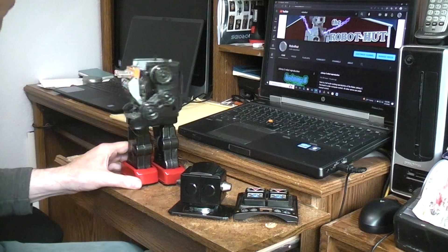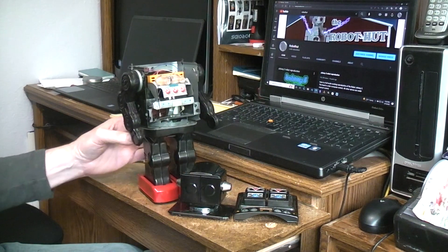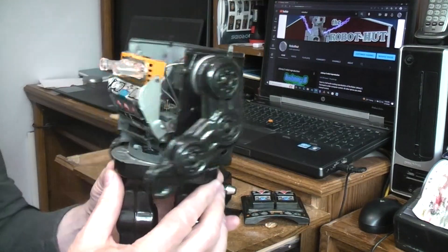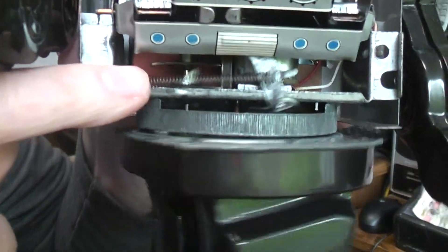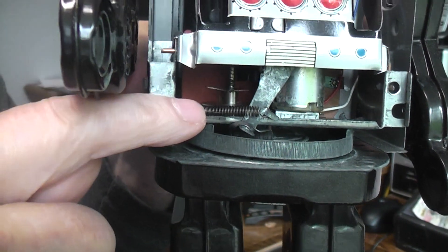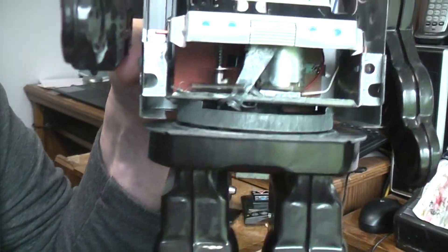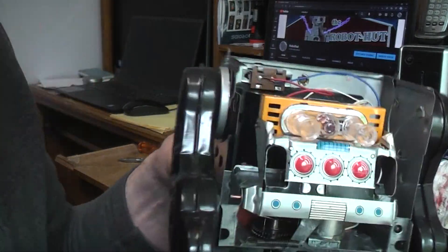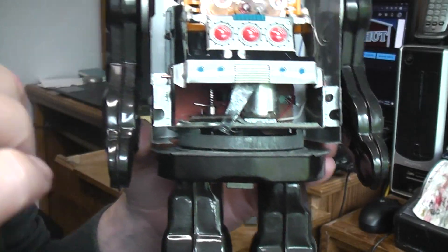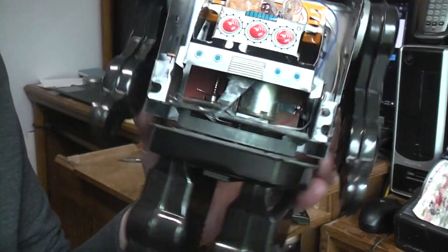The motor is really running like new now. Maybe you can see those gears I'm talking about. See how they've separated now and then it dropped back down — it does tend to hang up a little bit. I'm hoping the oil will work its way in. I'll play with that some more before I put it back together to make sure it's working the best it can — maybe the little ramp piece is bent a little bit too far out and catches, might need to be bent in. That would be a manufacturing error.